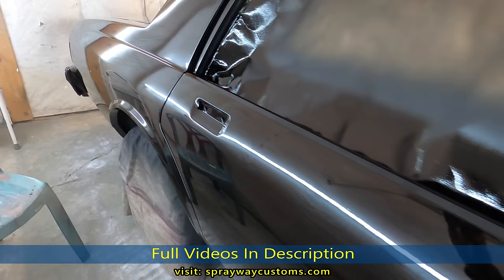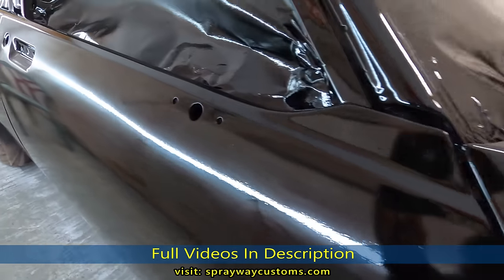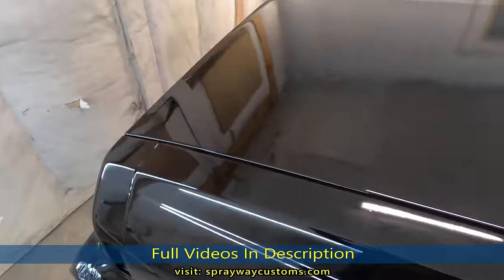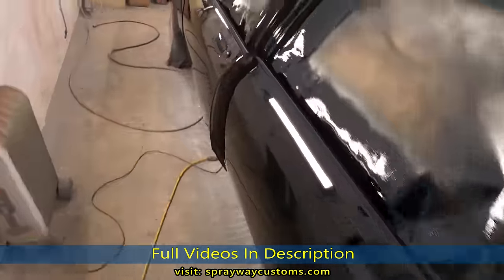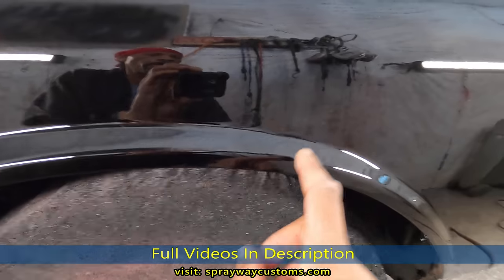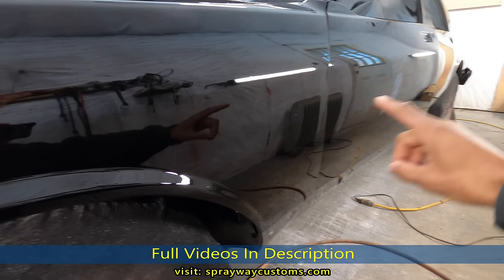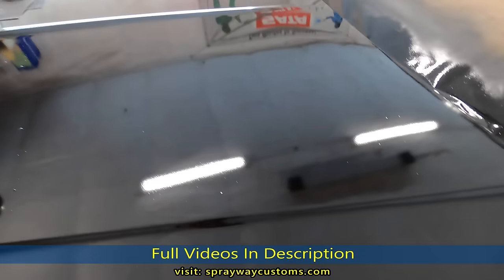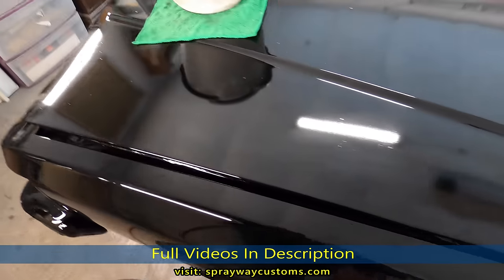And it looks a lot better from this part here. See the orange peel compared to the high solid. And also, I got a run over here that I gotta get out. I seen this when I had finished painting it. Right here, see this high solid. I had topped this off with high solid on this whole side, but the hood is straight value clear. I'm not sure if it's showing the orange peel like I'm seeing it,